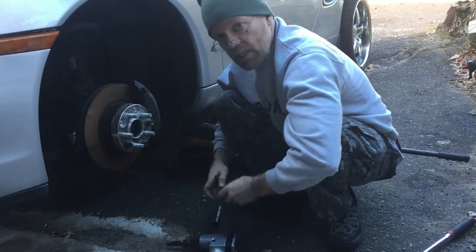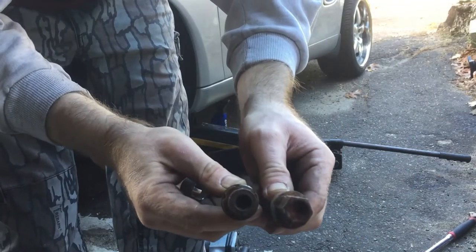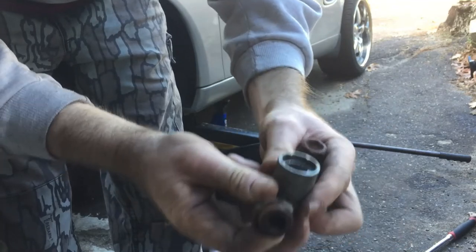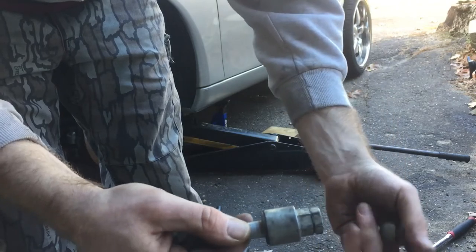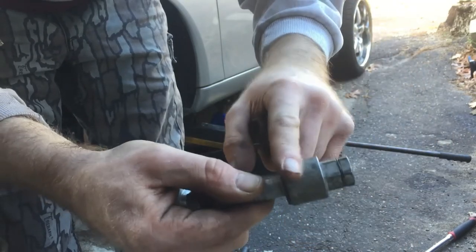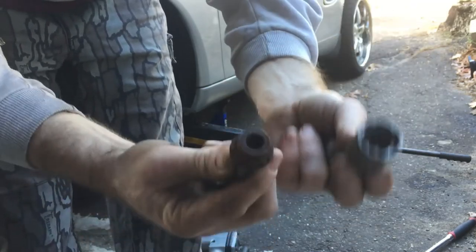Let me show you what the key looks like. If you see the top of it, it looks different from a regular lug — this one has a hex, six sides, and this one has all these little funny bumps. So this key matches this lug and goes in together. You slide it around until it meets. If you have it on wrong, it doesn't fit. Always put this on with your hands before you take a gun to it — if you have it on crooked, it will destroy both pieces.